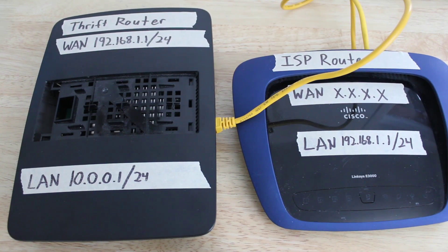Since almost all routers now come with Wi-Fi built in, you not only have an internal wired secure router, you also have an internal Wi-Fi connection. So you can connect your private secure devices to your internal Wi-Fi network like laptops, phones, and iPads, and connect your untrusted devices like IoT or Internet of Things devices to your unsecure Wi-Fi.